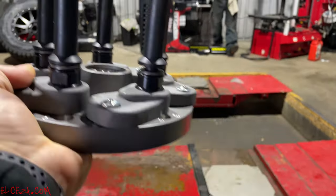We bring it back over here to the machine and go from back to balance. Of course. Again, guys, don't be that guy that decides he's going to do force match and go to lunch. Because somebody is going to come back and balance the tire while you're gone and you have lost your entire force match sequence. Okay? You got to start completely over. Don't do that. Do the set.